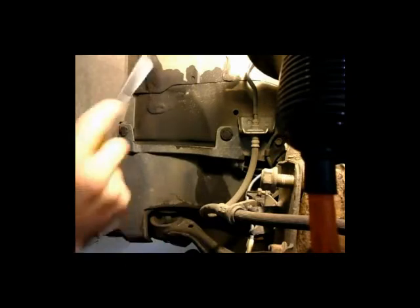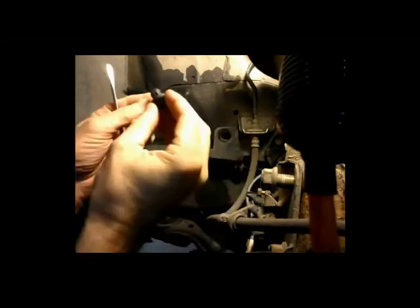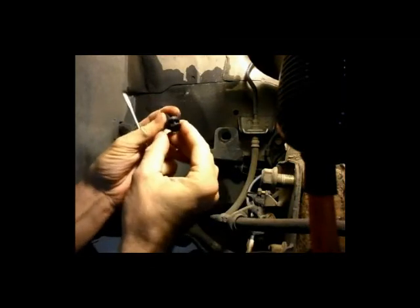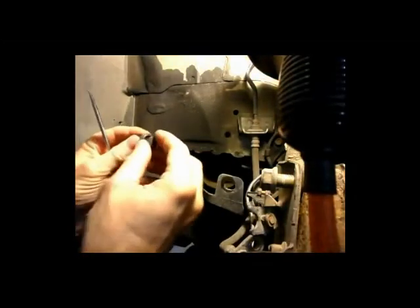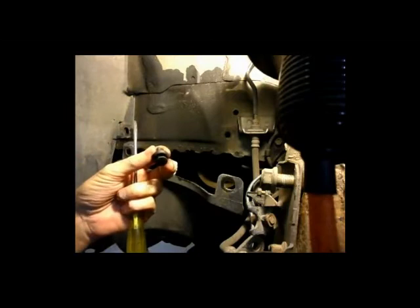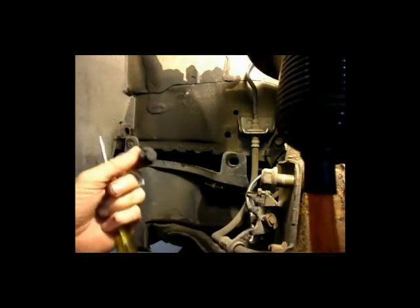To start with, you have to take the splash shield off — it runs all along the front of the car and up both sides. I'll show you how to get these little clips out without breaking them. If you gently pry and pop that center pin out, you can see it's the style where these collapse around the center part. There are about seven of them along the front; about four of mine shattered. These ones are a bit oily so they're not brittle. I'm going to have to order about ten of these to replace the ones that break.